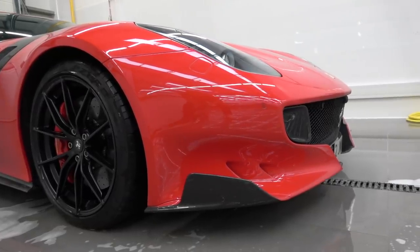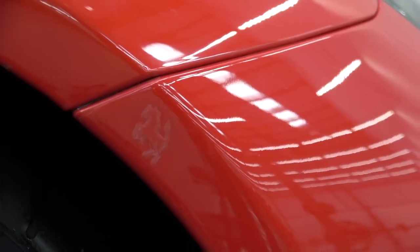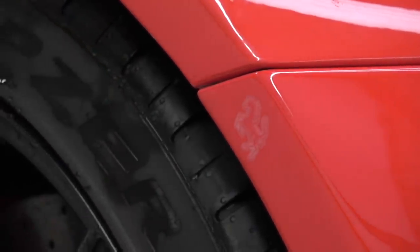The car has actually got some factory PPF on it. When you tick the box from the Ferrari factory to have paint protection film, you don't get the full body but you get select areas — the predominant area being the lower splitter and nose area, indicated by the Cavallino prancing horse on the side of the fender. This is a perfect time to say you might not want to get too close with your jet spray. Especially with paint protection film, you want to be quite careful with the edges — all it takes is a tiny little gap and the pressure from the water starts peeling it. Keep your distance, and if you have adjustable pressure turn it to its lowest setting.